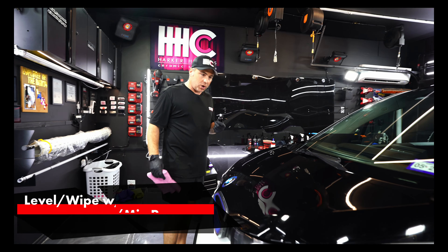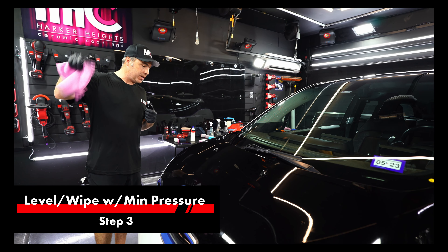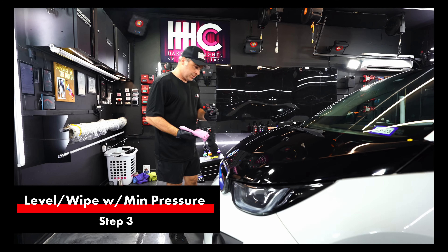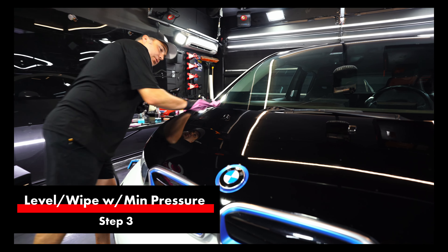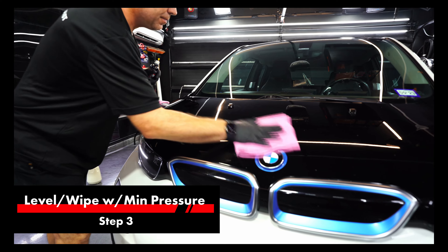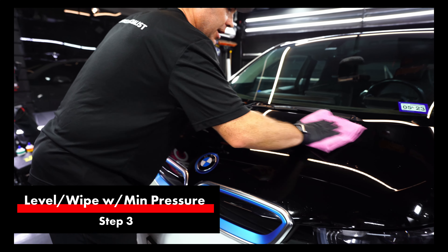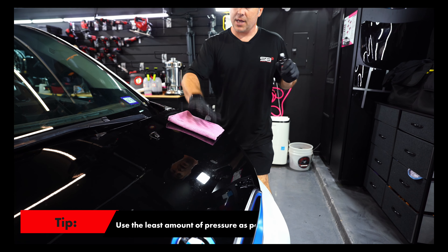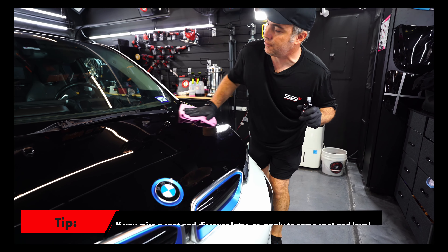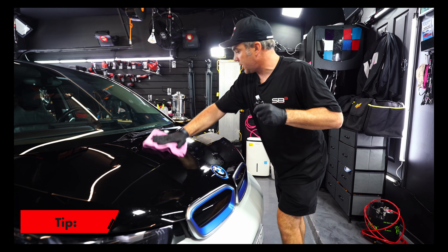So then I've got my Quadrant wipe. I can see a rainbow on my end, but we're going to give it a little bit longer — another minute or so — and then we're going to wipe. I see the rainbow, so I'm going to wipe. I love how this comes off; it's so easy to get off. A lot of coatings from other companies, if you've tried them in the past, you may find yourself looking from weird angles just trying to make sure you don't have residue. With SB3, one thing I love about all their coatings — not just 33 — is that it's so easy to wipe off. And it's really forgiving; if you miss a spot, sometimes you have quite a while, as long as you're not in a really bad condition area.